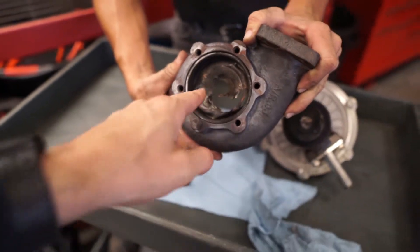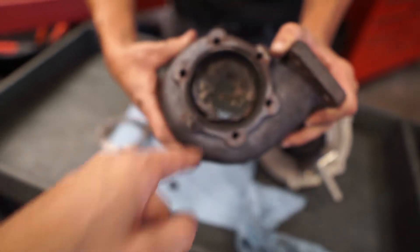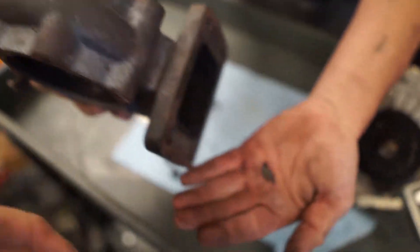We actually tightened the nut on the front one. I thought maybe we broke the shaft that goes to the turbo, but apparently the shaft is okay. We just broke every single blade off the back wheel for the turbo. That little oil shield thing inside the turbo — it actually ate through that and melted it. The carnage to the inside of the housing is just insane. Oh, more pieces.